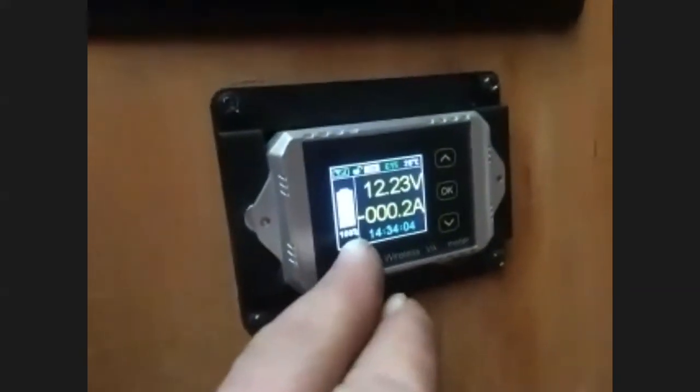Some useful things I've learned: when I ran my furnace with it 34 degrees outside in my tent trailer, I used 30 amp-hours overnight to stay at 54 degrees inside. With 200 watts of solar, on a cloudy day I was able to put back 20 amp-hours, but on a sunny day I was able to put back that full 30 amp-hours by noon. It lets you know how much power you have available depending on what you're doing — just like having a fuel gauge in your car.